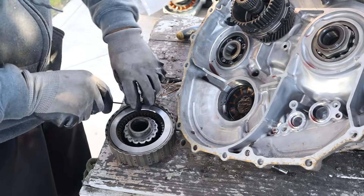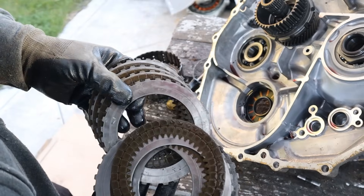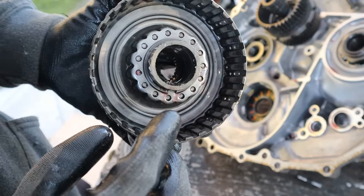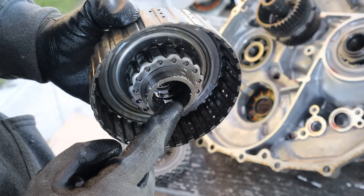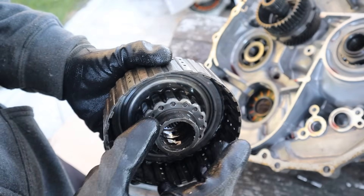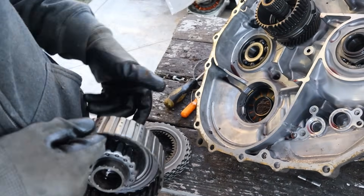Taking a quick look inside of these clutches after popping off the snap ring — the condition is generally used but in pretty good shape; they're not burnt or anything. To activate this clutch you'd apply fluid pressure fed through this tube back here, and that's what's going to pop this piston forward to lock up the input and the output together so you can spin the wheels.